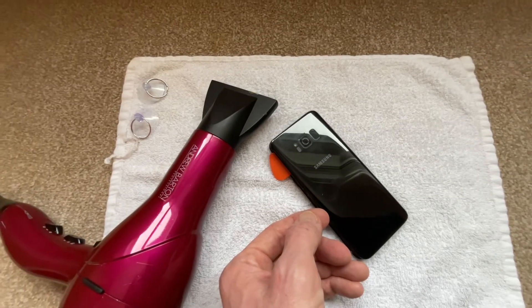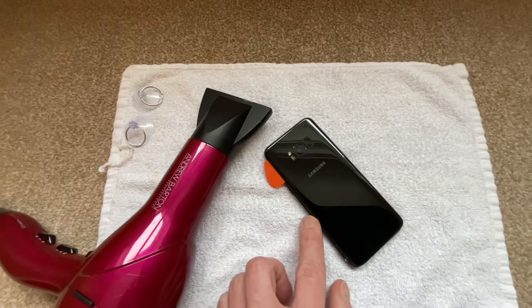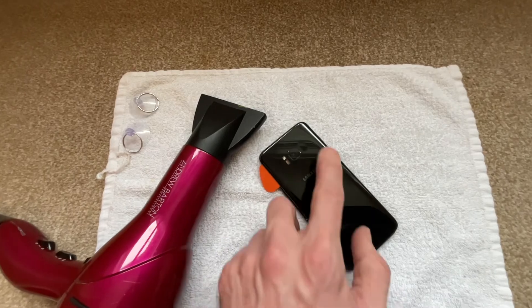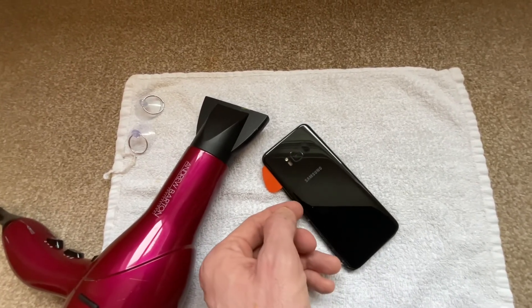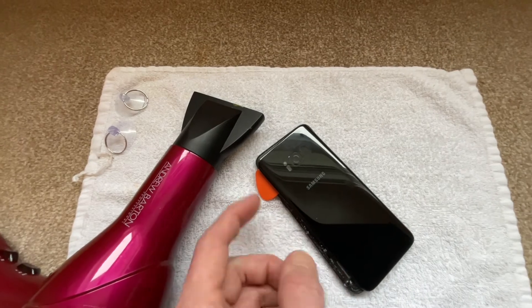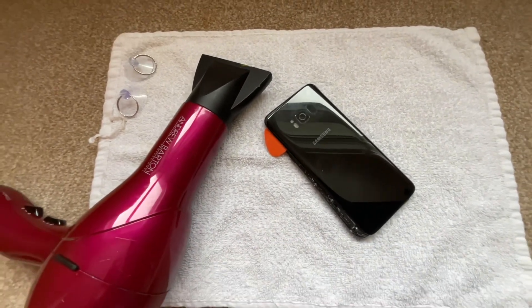So this was around 80 degrees for around about five minutes, and then that should be enough for you to lift up one side just to get a pick in — nothing too sharp — and then start heating it with a hair dryer just enough so that you can get it off. All I need to do now is disconnect the fingerprint scanner that is attached to this back cover, and then I can go about changing the battery. I hope you found this useful, thanks for watching.